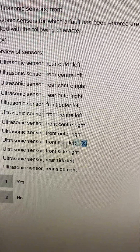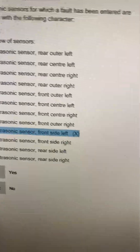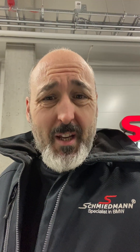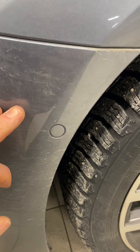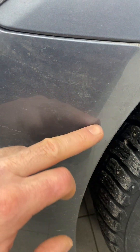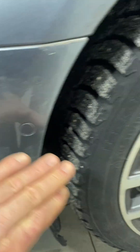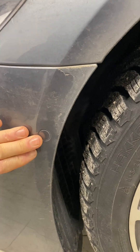Let's have a look - has it got accident damage or is it just got water ingress? Is it the wiring or is it the sensor? Sonic sensors are about 100 quid each, we don't have them in stock and you have to paint them usually. The easiest thing to do is quite simple - we're going to swap them around. There's no accident damage, the sensor looks tasty, no signs of any impact, but it's in a bad location. A lot of water and crap can go in there, so the easiest thing to do is inspect it and swap it.